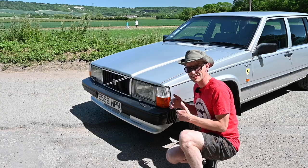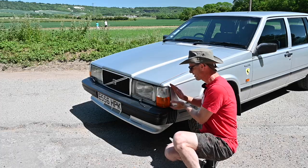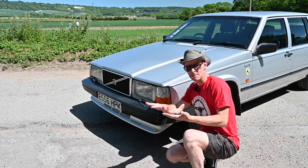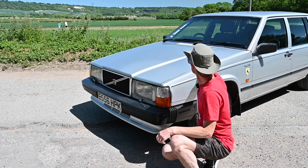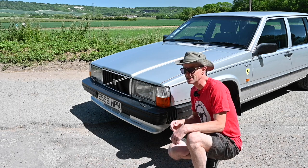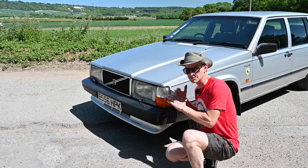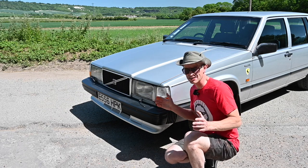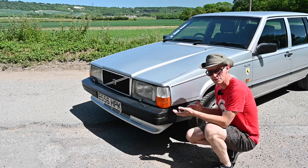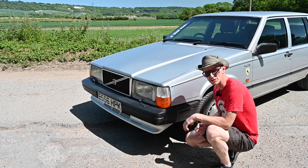Visually the most obvious changes came in 1989-90 when the headlights became slimmer and the indicators wrapped around further, and they made changes to the scuttle so the windscreen wipers were aerodynamically shielded. On this one you can see they're very prominent and proud, so they make a bit of wind noise and drag. Under the skin the biggest changes happened in 1987-88 when they changed the rear suspension to multi-link and started galvanising the entire chassis. Volvo themselves described it as almost an entirely new car. This 1988 car seems to have been on the cusp and avoided most of those changes, so this is a 740 in its purest form.